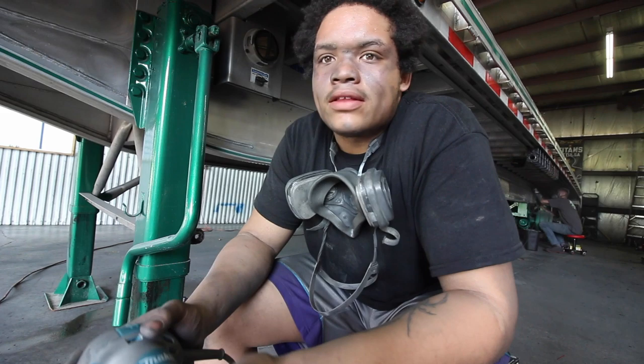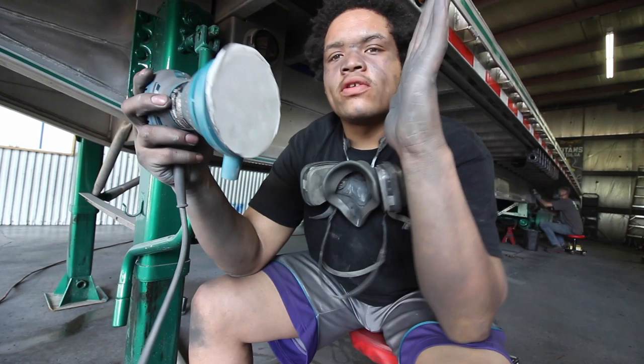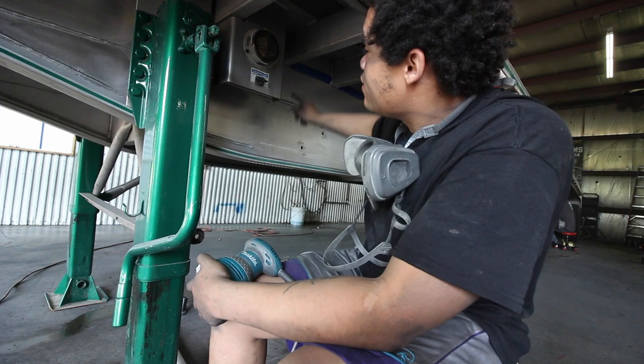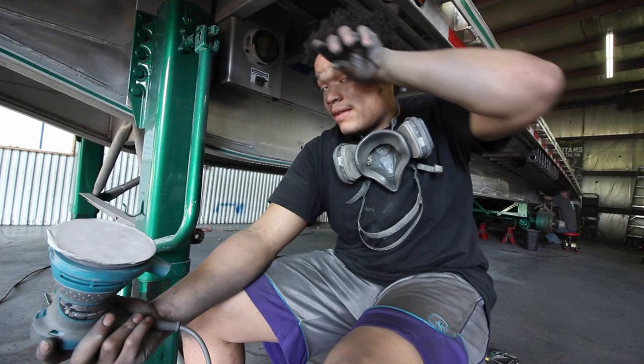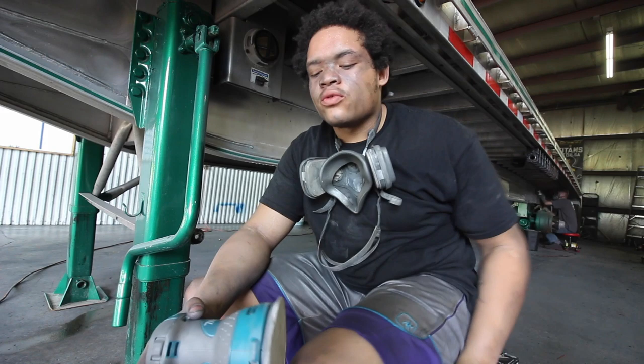I can't really give you an estimate of how much pressure you need, but you need just enough pressure to hold it down. And like I said, you're not holding it at any angles. You're always keeping it flat on. As you saw, I went from here to here, then here. Realistically, what I should have done was here, here, and then here, but it's the same difference. But like I said, you just want to take it slowly when you're DA sanding. And when you're rotary sanding, you don't want to let it sit too long, because you will leave half-faced moons or big lines and stuff like that. And it's just really hard to get out sometimes too. So yeah.